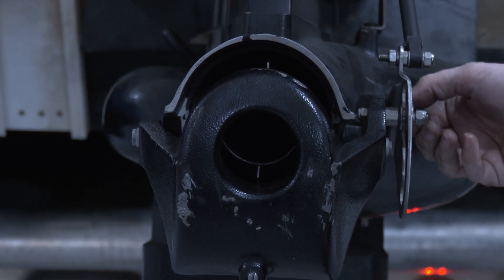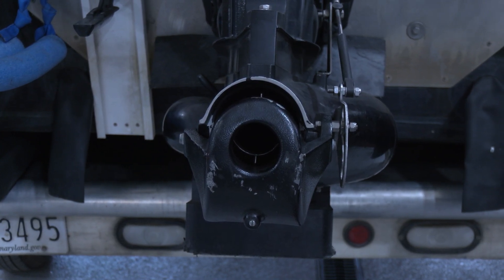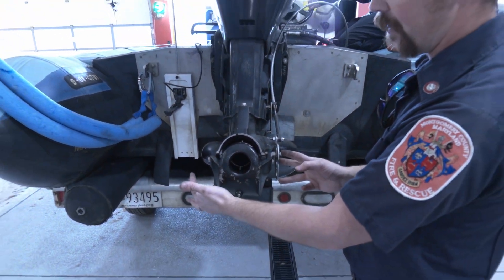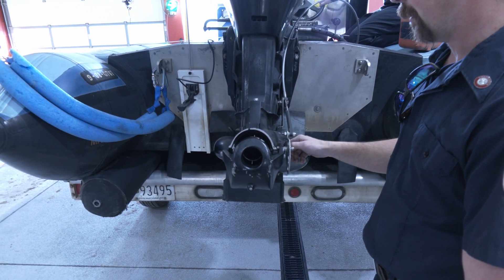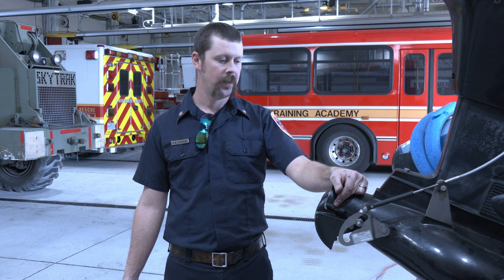If you do have binding, loosen the bolt, turn the nut, and bring the reverse gate down a little bit. If you're in the field trying to diagnose why parts won't fit together correctly, sometimes the ears on the reverse gate can be bent and you won't even know it looking at it — it will be hard to adjust. You may have to play with it to get it to shift. If you run across a reverse gate like that, it's better to just replace the whole thing. If you've been out on the river and broke a reverse gate, write it up using the JotForm link for special ops defects on the SharePoint, or use the QR code on the tongue of each trailer or inside the bow compartment.